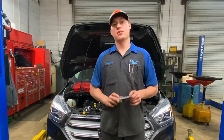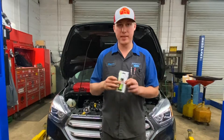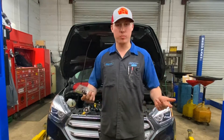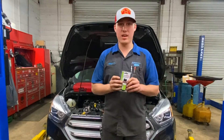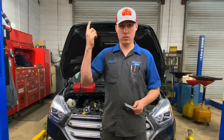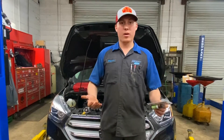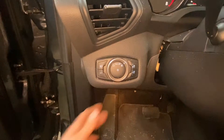The last thing you're gonna need is this Auto-Probe UV coolant leak detecting dye. It's basically a liquid you pour into your cooling system right in with the coolant and water, and it turns this neon green. You barely need any light to see this stuff. I like to pour this in all my vehicles even when they don't have a leak — because when they do start leaking, you back out of the driveway and you're gonna see this stuff on the ground. It's very very bright and hard to miss.